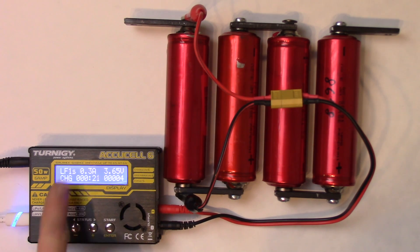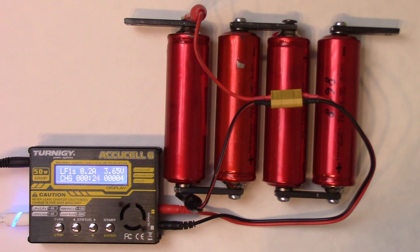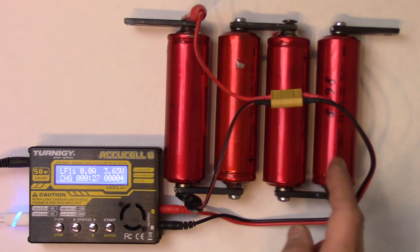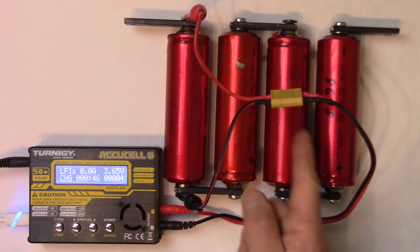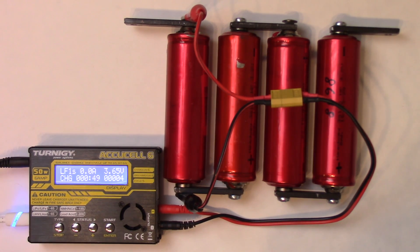Right now this battery is pretty well topped up, as you can see — it's down to 0.3 amps. Basically what I would do is cycle from each one down the line and top them all up, and I will do that before I start the car up. That's how I charge them. Now, I know it's not optimal. Probably the most optimal way would be to get a proper 12-volt charger that does LiFePO4 and have a BMS connected to all four cells so it balances them out correctly and protects them. It's a little tedious because you have to go through each battery one at a time as opposed to doing the whole thing at once. But that's how I charge these up.